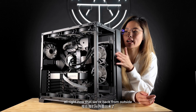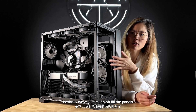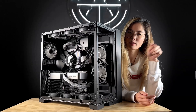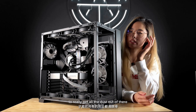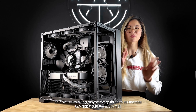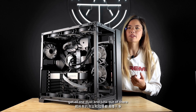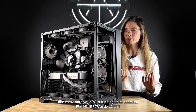Now that we're back from outside, we could decide to stop here. Basically we've just taken off all the panels, dusted off everything, gotten really in the fans with that AFMAT rechargeable air duster, and then taken a microfiber cloth to really get all the dust out of there. This is really great maintenance for short term — so if you're thinking maybe every three to six months, maybe even up to a year, every once in a while just take apart your PC and get all the dust and junk out of there. That'll really improve airflow and make sure your PC is running at its optimum.